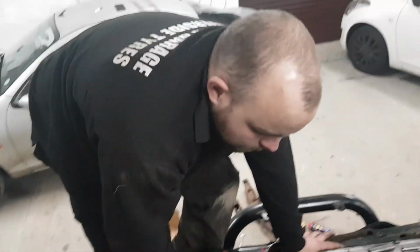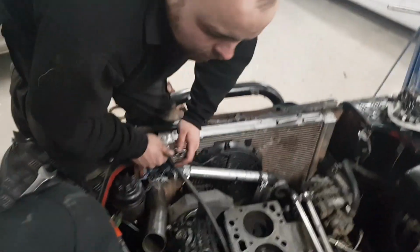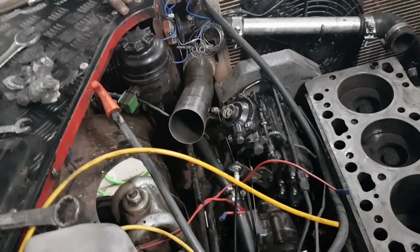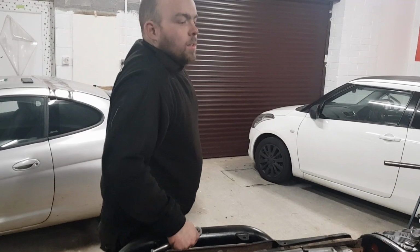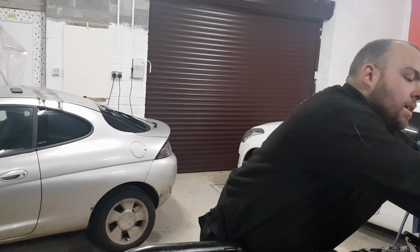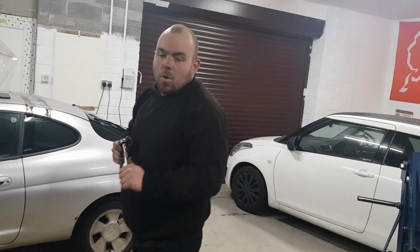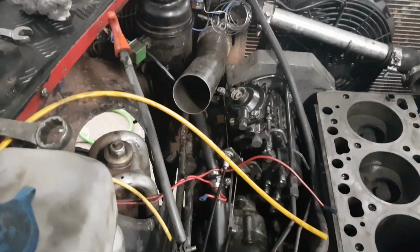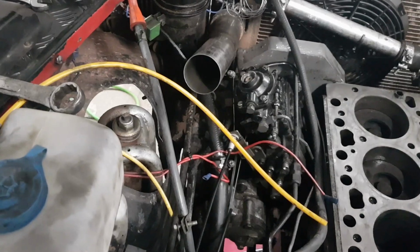And the Land Rover steering box can only take 65. So what happened, what is it, 2-3 times now? Popped the line, which ain't really an issue. And it's done 2 steering boxes. Always picks the best time to go as well, doesn't it? Yeah. So, we've bought a reconditioned pump that's been turned down to 60 bar. So, that's on its way. Yeah, we should be laughing.